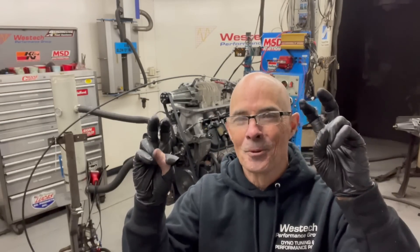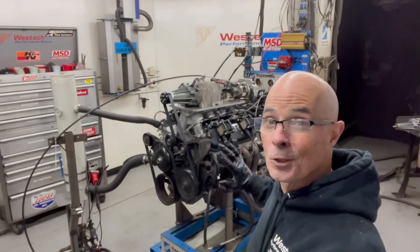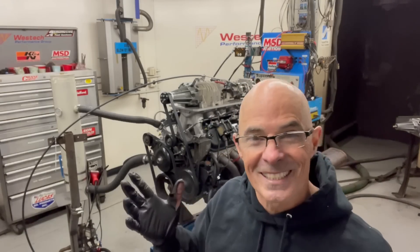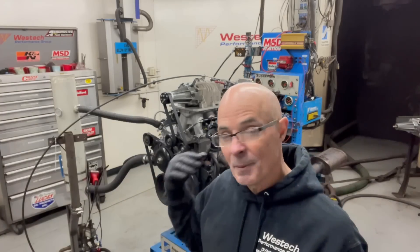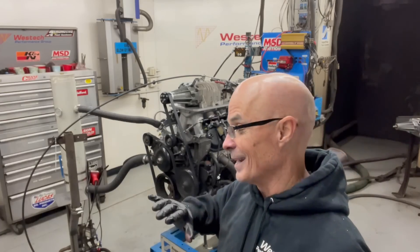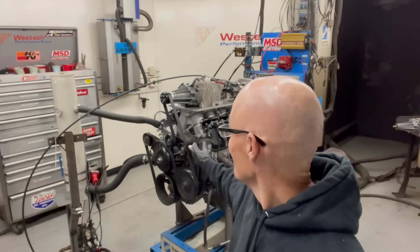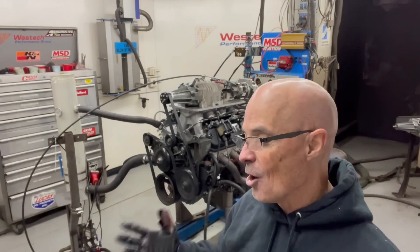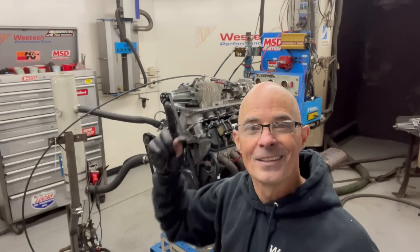We're going to try our super richie carbureted M90, so we need to remove the one we ran with fuel injection and also with the carburetor up in the elbow, then install our other super richie with fingers crossed — hoping the rotor doesn't touch the housing. We did all the clearancing, but you never know until it's under heat and RPM. I don't really care about the blower, but I'd like it not to take out this L33 5.3, which has been a really good soldier right from the wrecking yard.